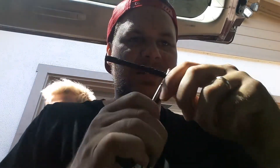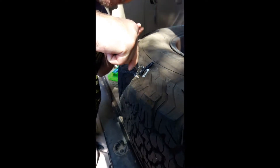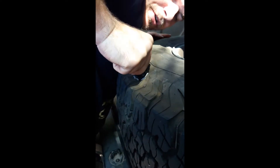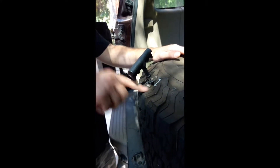It's probably easier if you had pliers, but you've got a whole tire to plug. They told me to get a whole new tire - that's 275 bucks. So here we go. Goes in - hopefully get this done on the first try. You want to go easy here because you could split it before you even get in, so nice and slow. See, it's starting to go in by itself. Just take it easy, go in as far as you can - that's not a bad idea. Right there - now from here you just yank it out. Hopefully the plug stays in and the tool comes out by itself.